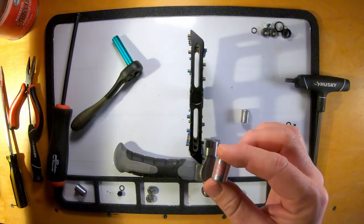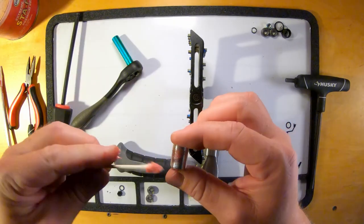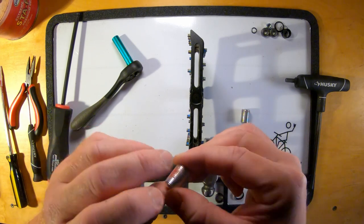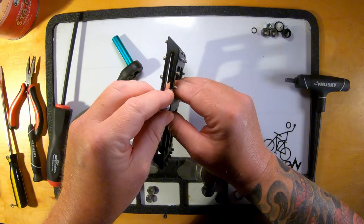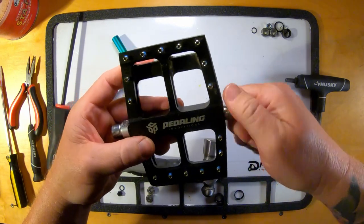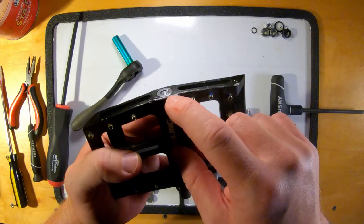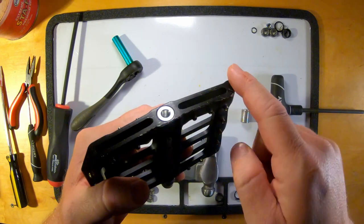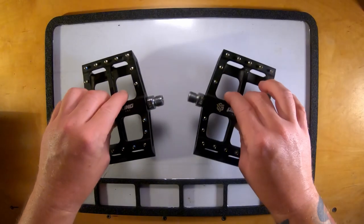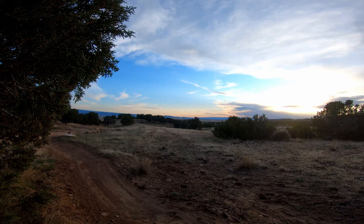After that, last step — put a little bit of grease on the end cap. I am not going hog wild with it, but over time as I smash this pedal on rocks, it will make the next service a little bit easier. Screw in your end cap. I like to put it so the end cap is just ever so slightly screwed in past the end of the pedal — that way as I smash it on rocks, it'll hopefully save the end cap so I can remove it easier. So there you have it guys, rebuilding a set of Catalyst pedals from Pedaling Innovations. Thanks for watching — got any questions, hit me up down below. See ya!